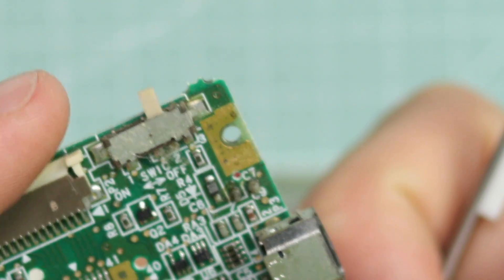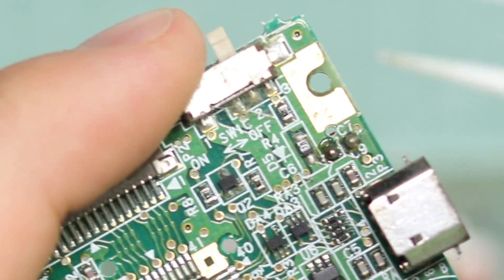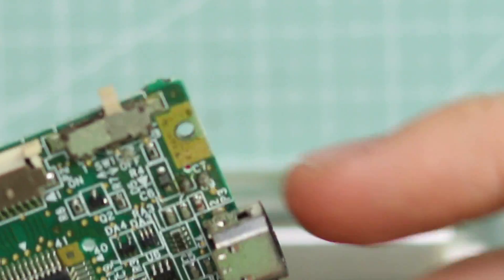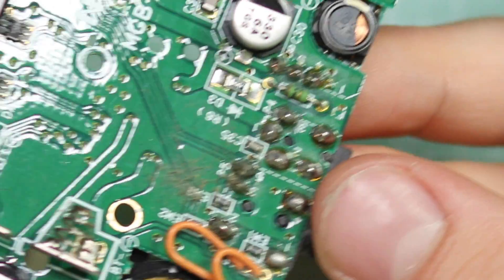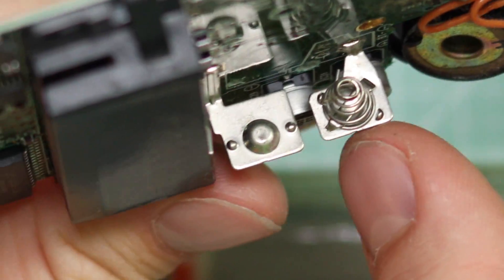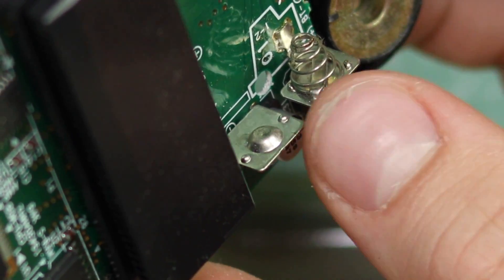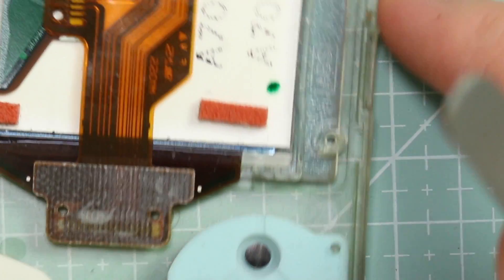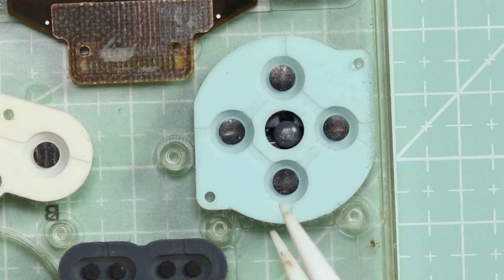The power switch is usually quite dirty — you can see there is a little bit of fluff and stuff that's gotten stuck in there, but that's because it's obviously open and exposed. We'll give the wheels a good clean, and we'll give the contacts a good clean — they're a little bit oxidized from exposed metal. Also, I want to try out the official Nintendo cartridge cleaner. But let's take a look at these buttons because this is going to be quite grim, I suspect.